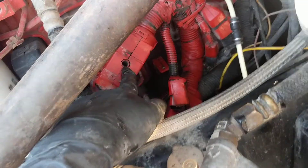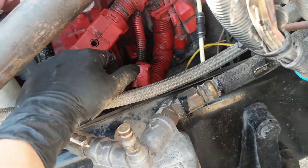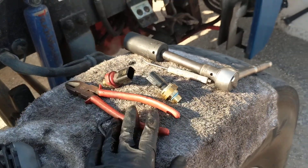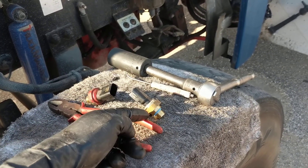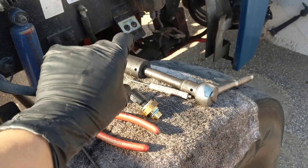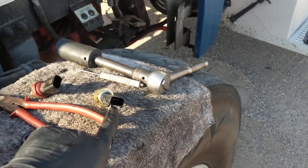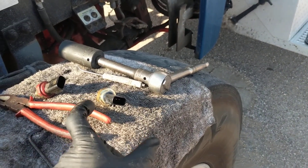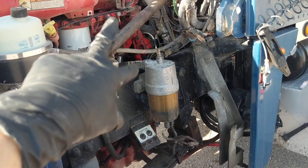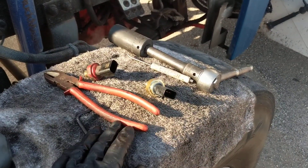You can see it's got those hex screws right here — it'll unscrew and come out. This is for some of you who might not know; I didn't know either — never removed that before. Then just go backwards: stick it in there, give it a half turn, just snug. This sensor is going to be facing down like that — plug it in, safety it, connect your two ECM plugs back, boom boom, make sure they're nice and snug and you're good to go.